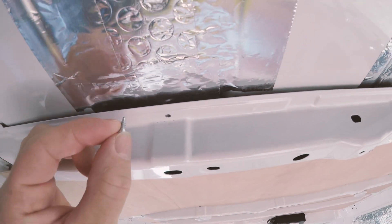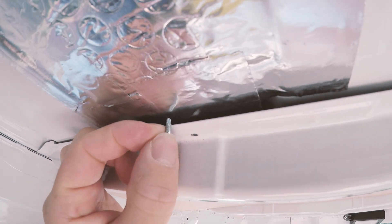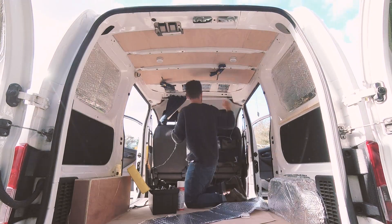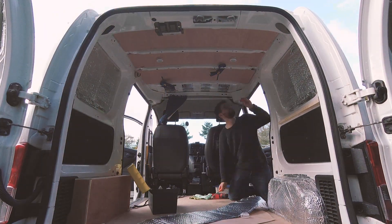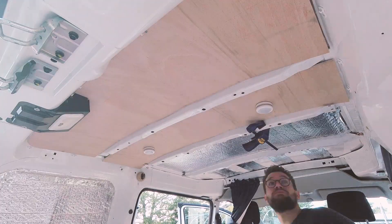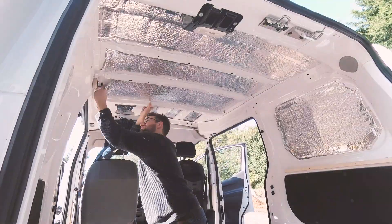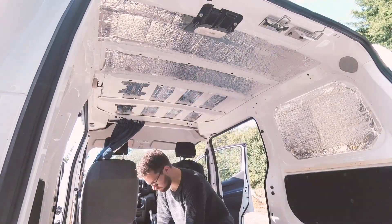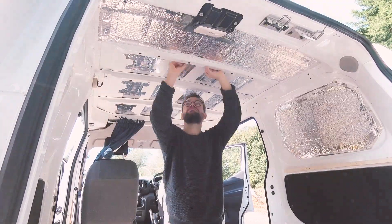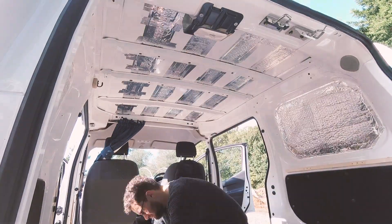The ceiling panels are ones that I cut to size and screwed into the edge of the ceiling beams. I used 3.6mm ply and countersunk some 4.2mm self-drilling metal screws to attach them to the ceiling without going through the roof. After removing the plywood panels, I removed the main insulation and started coating the holes made by the screws in metal primer to prevent any rust in the future.